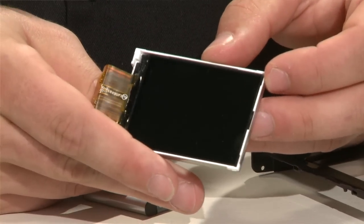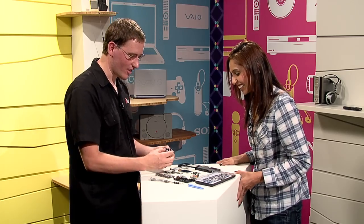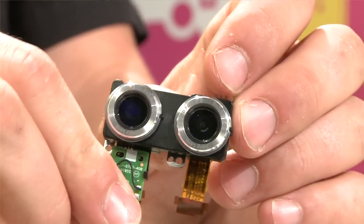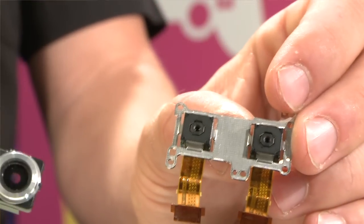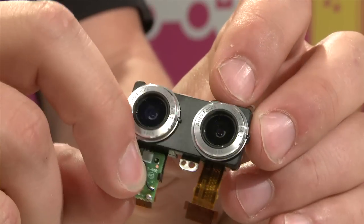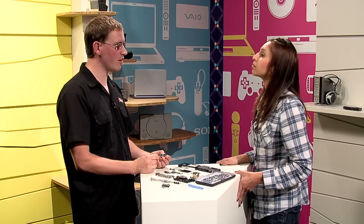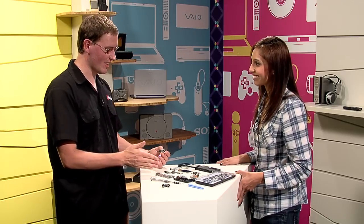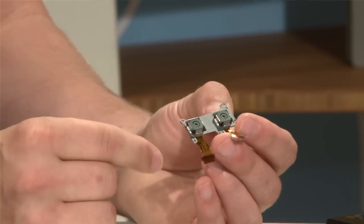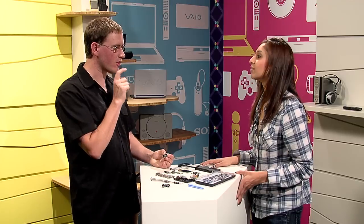Got it. That's important because we're not always carrying glasses. I don't really want to be wearing 3D glasses when I'm shooting video. And the 3D effect is created by rather small cameras — you look at this and you think this is the camera. Check this out, I'm going to take the cover off. And you can see these are actually the cameras underneath — a little R2D2-looking covers. But the cameras are quite small. These are two 5-megapixel cameras. The Bloggy can shoot 5-megapixel still photos, or when you switch to 3D mode, it combines the image of the two cameras. That doesn't mean you get 10 megapixels — it means it's interlacing the images together to create a 1080p 3D video image. In order to get a 3D effect you have to have two separate cameras, giving you two separate vantage points, just like your eyes are spaced apart.